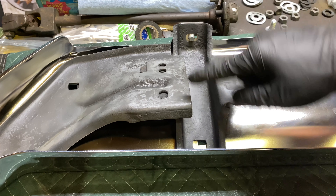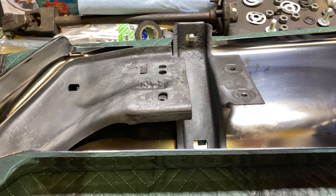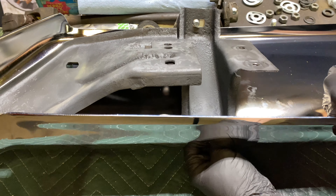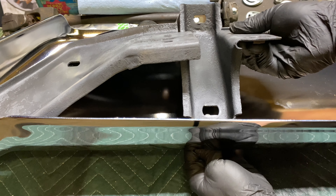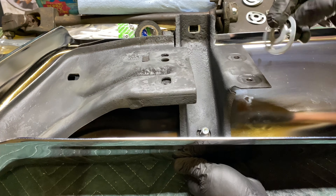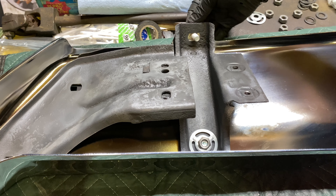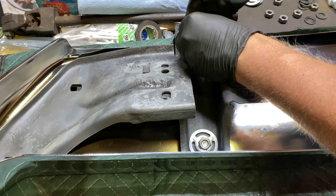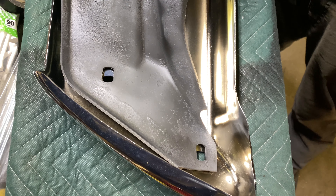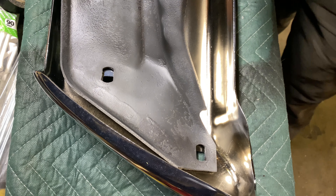These shims — they give you eight in the kit, but you really only need six because you can't get one under here. If you look at the plain galvanized bolt, the head is not cut out for the washer to sit flat evenly. But if you look at the stainless steel bolts, you can see they're actually cut out on the corners — that's to allow the washer to sit down flat like it's supposed to. So a shim does not go under the bottom bolt, but it goes under the rest of the mounting points. So you're only going to need six of them, but they give you eight in the kit.